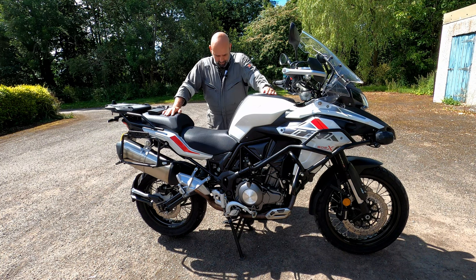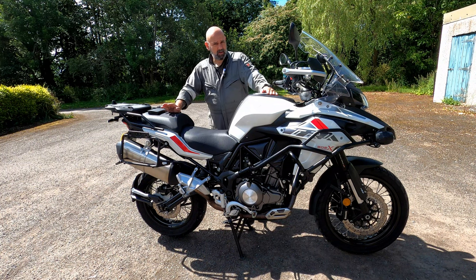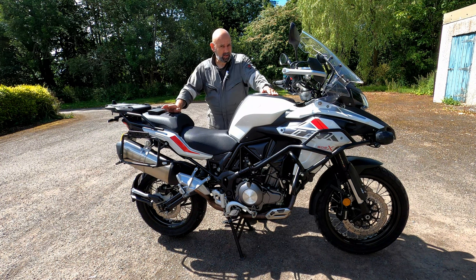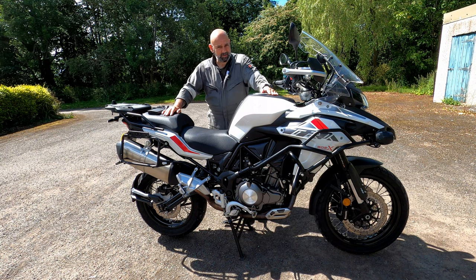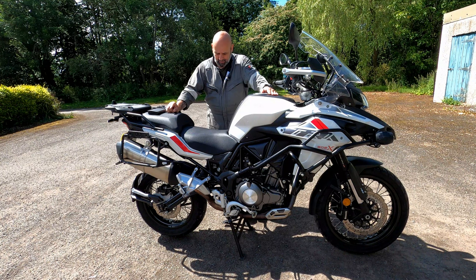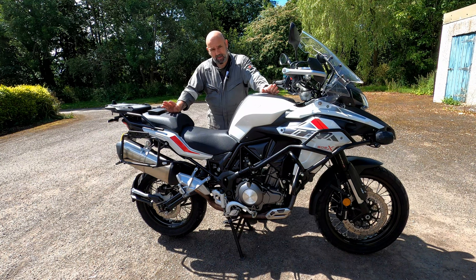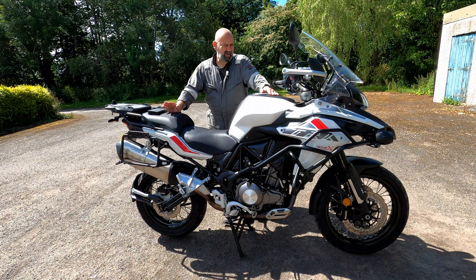Welcome back. The state of play at the moment is this bike has got a shade under 11,000 miles on the clock. I have noticed that when the chain is becoming a little bit dry, ready for a good clean and oil, it is beginning to make a little bit of noise. Inspecting the chain, it doesn't look too bad, it's not that rusty, but every now and then there does seem to be a stiff link and that's what's making the noise. A little bit of oil on and it frees up fine. The rear sprocket is also getting a little bit worn, so I think it's time to get it all changed out.